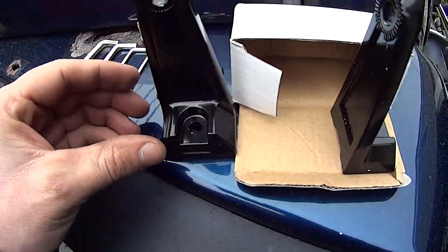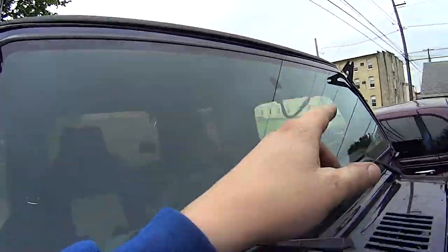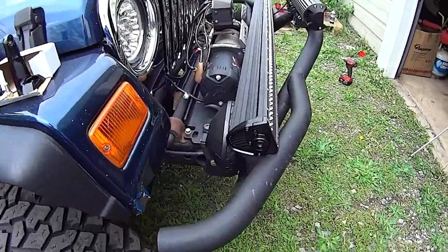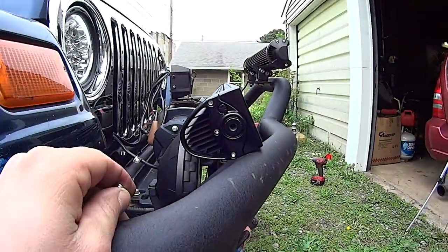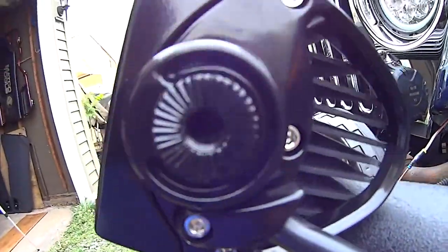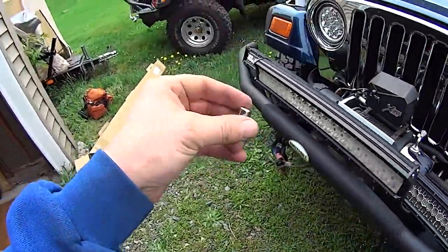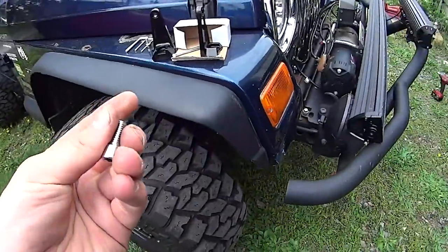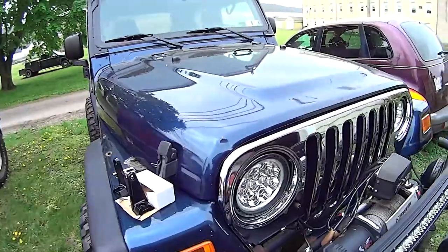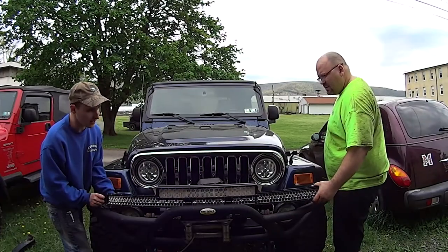Some guys will just run a plate right across the top of the roof or mounting point and drill right in. Looking at this now, unfortunately when Auxbeam did this up, they painted the threads inside where the hardware goes. So I chased out this side just with the bolt — would have been better with a tap. Do the other side. And then I just need to find some washers for inside and outside for the brackets. Now comes the fun part.